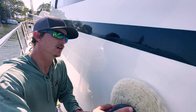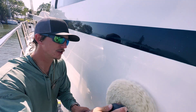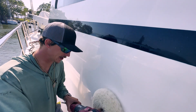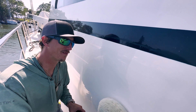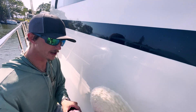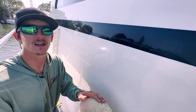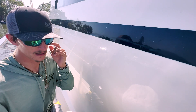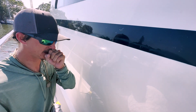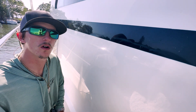I'm on speed two, which is right around 900 to 1000 RPM — personally I think it's a little higher than that. Flex buffers seem to run so fast; their one is not your normal 600 RPM like a Dewalt — you can hear that difference. So I treat them a little bit different. On my Dewalt, I'll start in the 700 to 800 range, and then I'm typically finishing out around 1600 RPM.